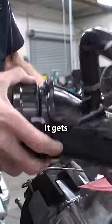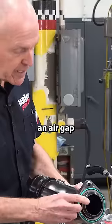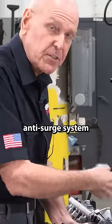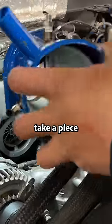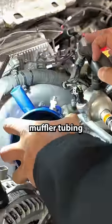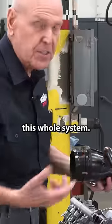It's quite large here, and it gets to be compressor inlet size here. There's an air gap that allows the compressor re-circ anti-surge system to work. If you remove this and just take a piece of three-and-a-half-inch muffler tubing, put a flange on it and stick it on here, you defeat this whole system.